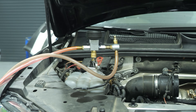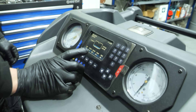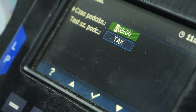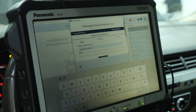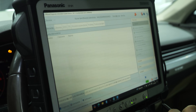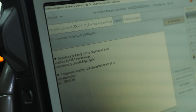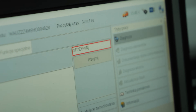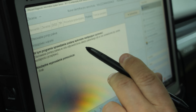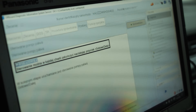We also fill the air conditioning system with new refrigerant and oil. Before starting the engine, we perform the entire pre-start procedure according to the technical instructions. We start the ODIS diagnostic tester, log on to the manufacturer's online systems, and perform all required actions one by one: updating the engine controller software, adding the IMA/ISA codes of the injectors, assigning the fuel pump, adapting the turbocharger, bleeding the fuel system, and adapting and parametrizing other components. In the case of cars with a 48-volt installation, we additionally switch on a system that was disconnected for repair work. Only after this has been done do we start the engine.